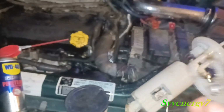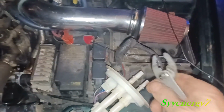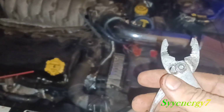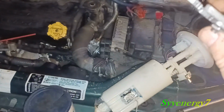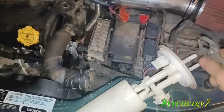The other thing I do is when you're taking out the fuel fittings, you've got to squeeze together. There's like a plastic thing on here. You crimp it together, and you can do it with your fingers, but it's easier to do it with pliers. I always love these little skinny, cheap pliers that came with an old '74 Toyota Corolla. I use them for everything. They fit in little places, just perfect for squeezing that fitting together so you can pull off the lines.